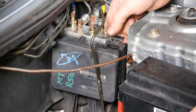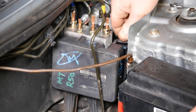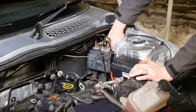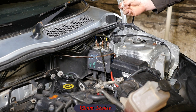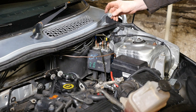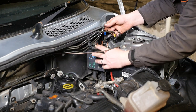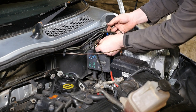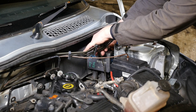With this plug, lift the lever up — it disconnects it and actually pushes it away slightly. There's one bolt here which is 10mm, though I managed to take it out by hand. I think this ABS unit has been replaced before — it has a lot of writing on it which suggests it may have come from a scrapyard.